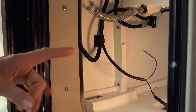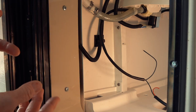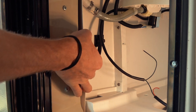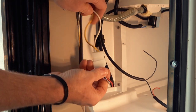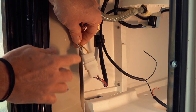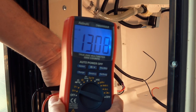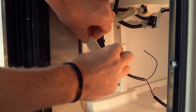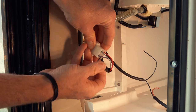The fan needs to be wired into power. Since the toilet runs on 12 volts, there should be a connection close by. In the Revel, there's a cable tucked into the side — a yellow and a white wire. Winnebago color-coded it so yellow is always +12 volts and white is ground. On the other side of the plug, the red connects to yellow for 12 volts and black is ground.